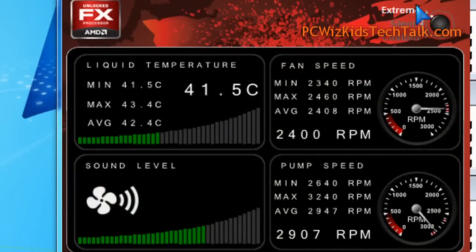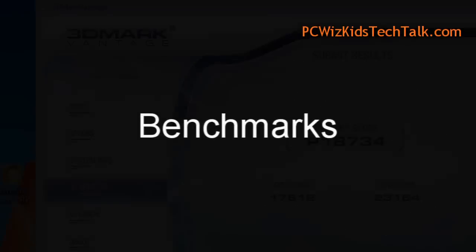Here is the utility for the liquid cooler from Assetek. It shows you the RPM of the fan speed. I have it on extreme settings, and it is very loud. I'm running it on extreme settings because I'm overclocking and running all eight cores at 100%. If I run it on regular silent mode, I won't be pushing all eight cores, just regular gaming use, and then it's nice and quiet. The cooler is good for everyday use, but I wouldn't really use the Assetek cooler at 4.6 GHz because it gets very loud.